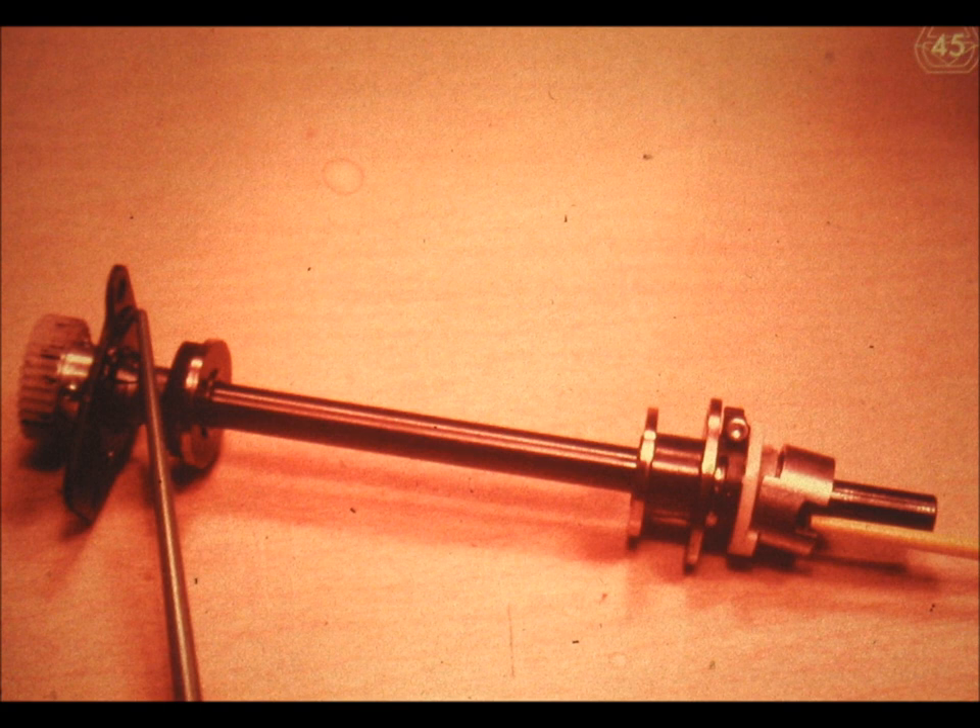All the while, the cam or the shaft keeps rotating top to the front of the machine. After a certain amount of this rotation, the check pawl falls behind the tooth of the check pawl ratchet on the left side of the cycle shaft. The same occurs with other clutches, where after the disc or sleeve stops against the latch or release arm, the cam continues to rotate until the check pawl engages with the check ring. Once this has happened, the spring tension has already become trapped because the cam or shaft can no longer rotate top to the rear, as the check pawl would prevent it.